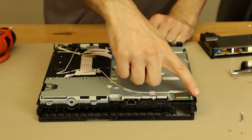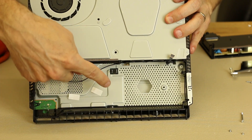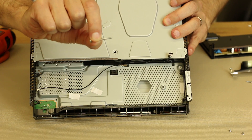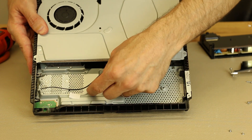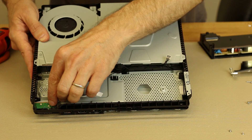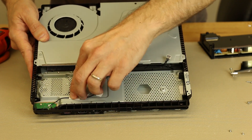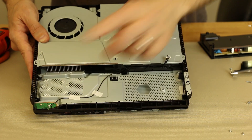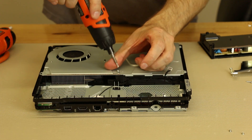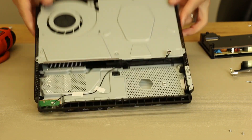So that is the top plate, the screws, and the WiFi antenna for the top. This is the hard drive enclosure where the hard drive goes. We need to reroute this WiFi antenna, and we also need to put in this large long screw. I'm going to route this WiFi antenna first — flip up this tape, put it in here, and it goes to the connector labeled B. Then drop the tape down to keep it out of the way of the power supply. Then we'll put in that one long screw in the middle. Now we're ready for the power supply.